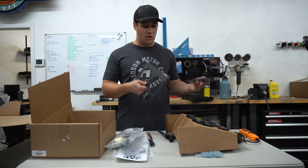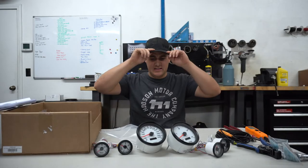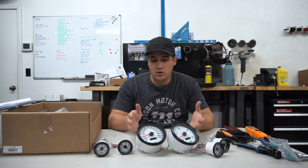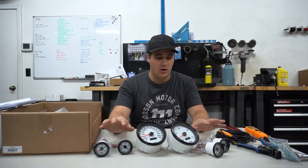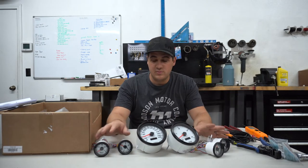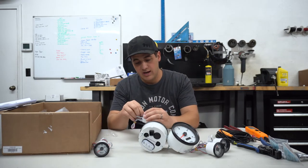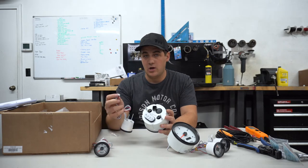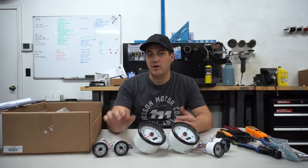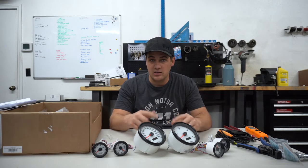You might have to get a little custom and do a little bit of trimming to get these things to fit absolutely perfect, but straight out of the box you should be able to just put them right into your dash. So let's get our gauges assembled. These are kind of modular in the sense that they go into the gauge bezel however you want — the speedo and the tach are interchangeable, and all four smaller pods are interchangeable. Something great about this is once you put power and ground to the two main units, all the computers that control the smaller units are contained in here. Your small units will plug right into the back of your big units, so they all get power and ground together. There's no need to run power and ground to each individual gauge like you would with Auto Meter.